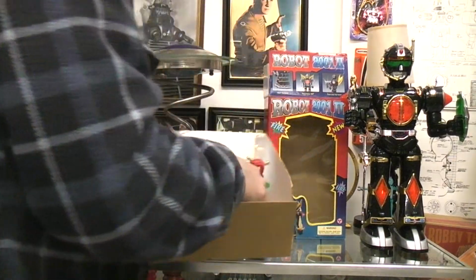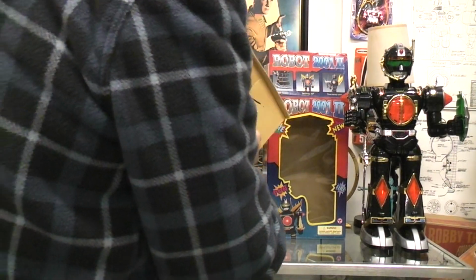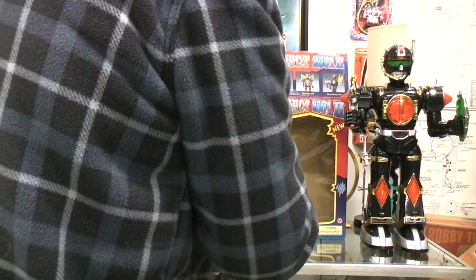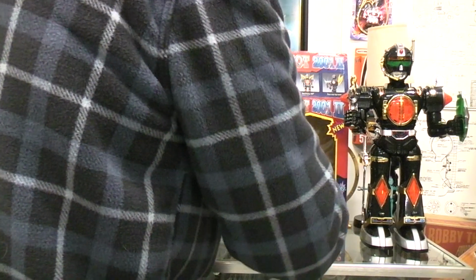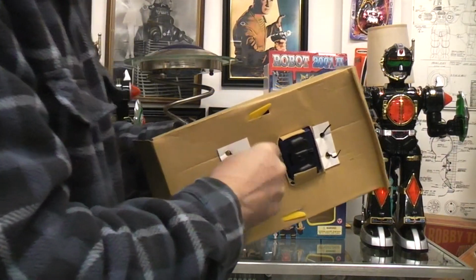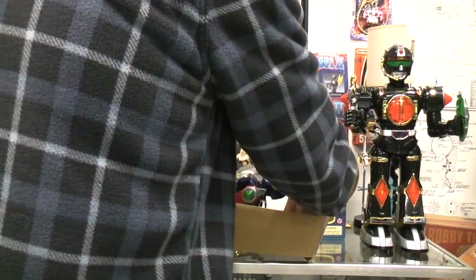Well, this one is still wire tied into its backboard. So there's a possibility it's never even been out of the box before. We may be doing it first. If it's never been out of the box before, then there's a good chance that the motor may not want to run. Just depends how the grease is set up on the commutator brushes. I know you can't see much when I'm undoing these, but I like standing over the counter in case I drop something that doesn't fall too far.